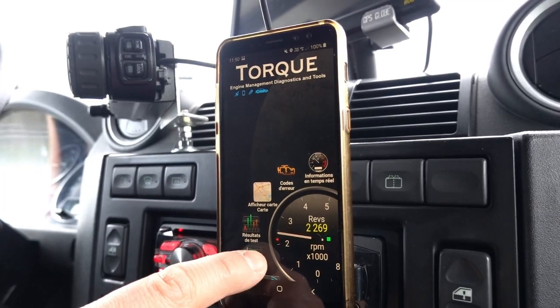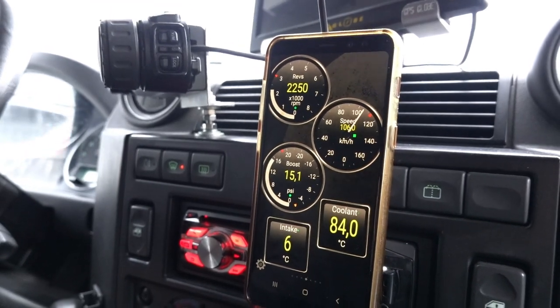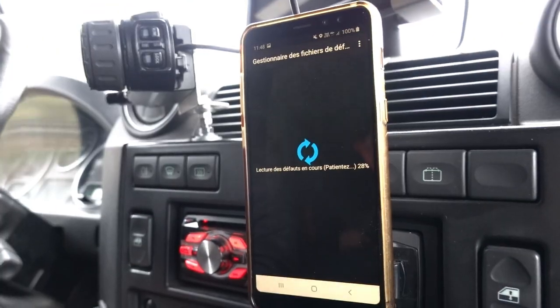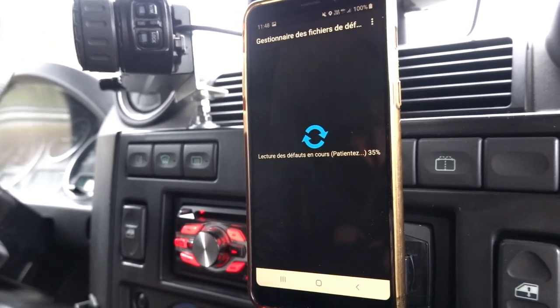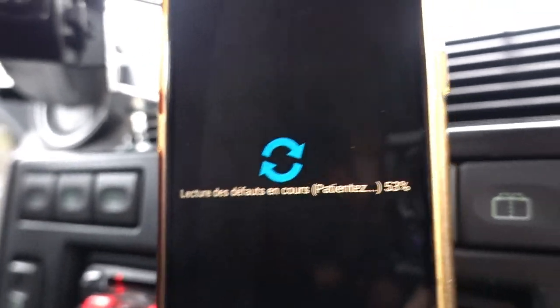For those who don't want to invest in this kind of expensive device, luckily there's a much cheaper one. A small OBD box which simply plugs into the vehicle's OBD2 socket and sends the information via Bluetooth to a smartphone, a tablet or a computer. We used this system before investing in a Nanocom and we still use it today. To be able to use it properly, it's important to download a Torque Pro application that costs around 2 euros. This is to be able to check in real time a lot of information such as the turbo's pressure, coolant's temperature, etc. With this app, it's also possible to erase fault codes, but be aware that you won't access certain functions such as the alarm, ABS or injectors, for example.